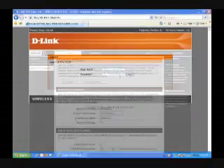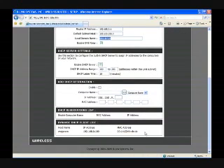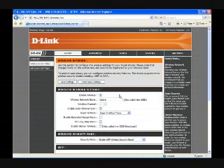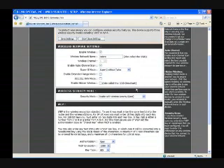The network settings should be familiar if you've ever set up a home router. You can change your IP address and range, configure DHCP, and view computers currently connected to the router. On the wireless side, you can enable or disable the wireless access point, change the SSID, and select a channel. You can also enable D-Link's Super G mode — an extended range mode which can boost throughput and range with certain adapters. More useful is D-Link's Auto Channel Scan, which allows the 450 to automatically select the clearest channel for your Wi-Fi. In terms of wireless security, the 450 supports WEP, WPA, and WPA2 — though nobody should be running WEP unless absolutely necessary, and if you have to, assume that unwanted strangers are using your network.